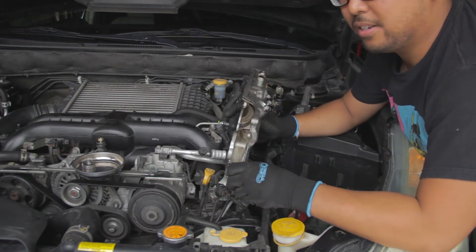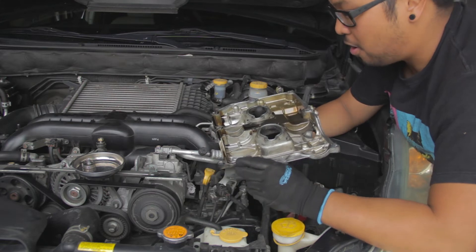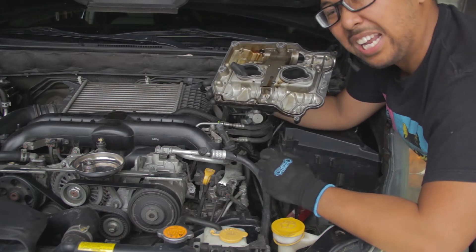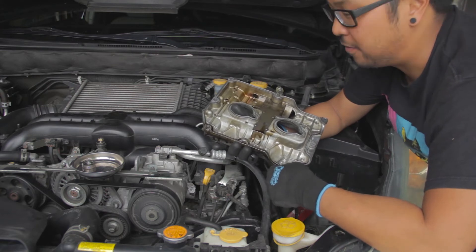In Brian's video his comes right up, but this one I had to turn it and pull it up to clear. All the gasketing stayed inside so it's actually in there — make sure when you take it out you get it all out, because if you leave any behind it's going to leave a bad mating surface and you'll have leaks.